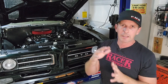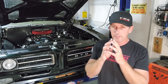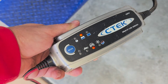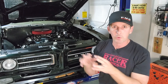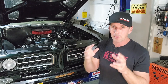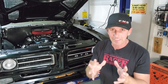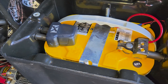I automatically jumped to conclusions — I thought it was the battery. I got towed home. Well, I had a few days to think about it. The one thing I typically do every time I go on a trip is I put it on my CTEK tender. Two days prior to the cruise we had done the port injection conversion at FITEC. I'd driven up there, driven back again, 150 miles or something like that. I did not put it on the tender. Then I went to the cruise — a hundred miles up, a hundred miles back. The battery lasted that whole time. I have a yellow top Optima battery; it's a year and a half old. There's no way that's bad. So that's what leads me to believe it's the alternator.